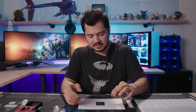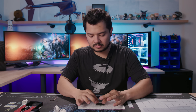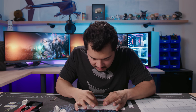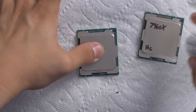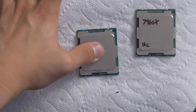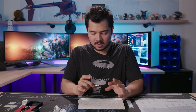What I've learned in recent weeks is that most people who delid their CPUs opt out of permanently resealing the IHS — just to make it easier to get in there later if they want to reapply liquid metal. And you don't really need to, honestly. The actual pressure of whatever socket you're putting it into will keep it clamped down enough, and as long as you're careful when handling it, you should be fine. I've actually got another Skylake X processor here to model after, just to see exactly how the IHS lines up with the substrate. So we're going to drop this into a test system now — the same test build I used when I realized it was overheating in the NZXT Elite build — and sure enough, even in this test build it was spiking up to TJ Max.